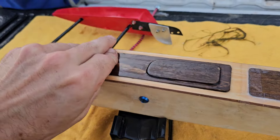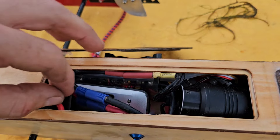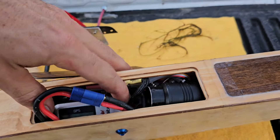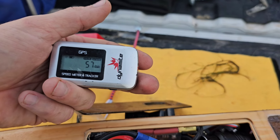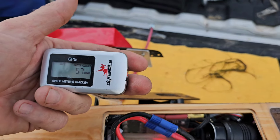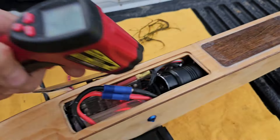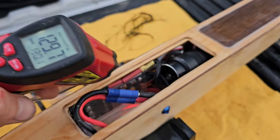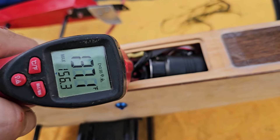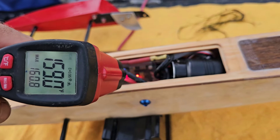Let's go ahead and open it up. No smoke — that's a good sign. 57 mph on the high voltage pack, not bad. I think I got 58 on it at my pond, so that's not terrible. Let's see what the temps are: 130 on the motor, ESC I'm going to assume 140 — and yeah, 150 on the EC3 connector. She's hot.